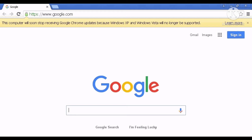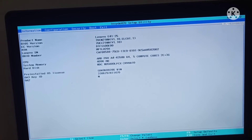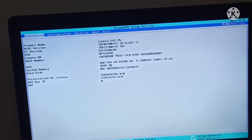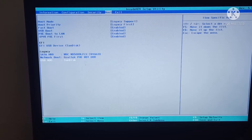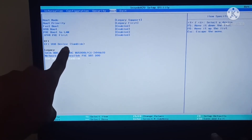Turn on your laptop and enter your BIOS key — in my case the BIOS key is F2. If you don't know the BIOS key, you can search on Google for the BIOS key for your laptop. After you enter BIOS settings, the keypad and mouse will not work, so you have to navigate with the arrow buttons. Go to the boot settings and go to your USB pen drive — bring the USB to the top to boot from USB.